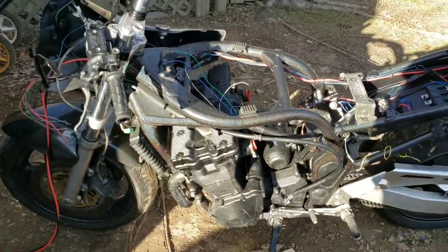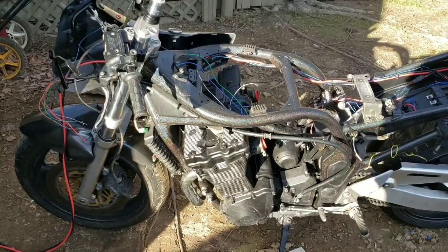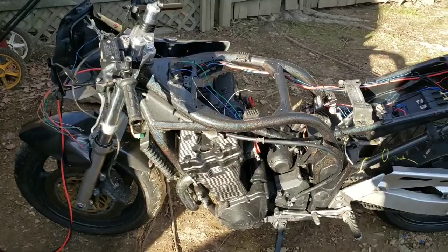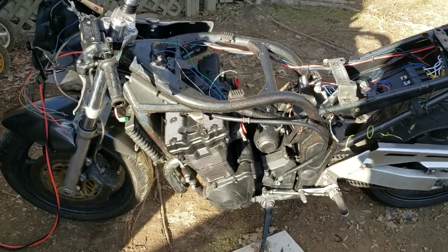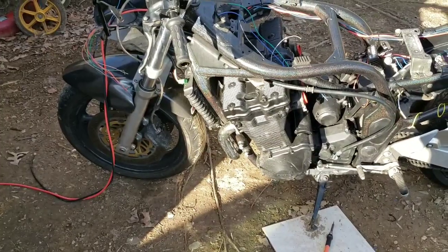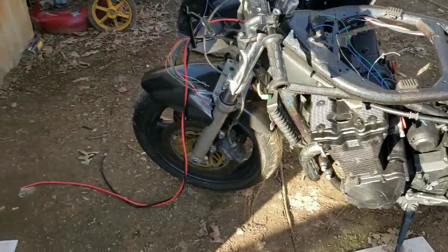Everything's off getting welded. It should have been welded yesterday or getting buttoned up today. So I got to pay for that tomorrow, pick it all up, and we'll get the throttle bodies on next. Get that all wired up in the sub harness, which I just took into the house. Put on for the injectors and the throttle position sensor. Then coolant sensor in the pan, so I got to drop the pan, change that. Intake air temp sensor, I'll probably weld on myself with the flux core, even though it's nasty welds.